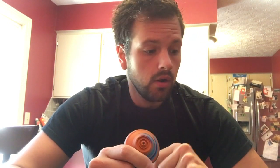Now, these are new, so the groove is already set and ready to go. What you're going to have to do is get your pad out of there, or the old silicone. I use a toothpick usually. That helps. You can get all the pieces out. Basically, you want as much metal exposed as you can for the new silicone so that it'll stay in there well. You can use a baby screwdriver, like I said, toothpick, X-Acto knife. All of those will work well.